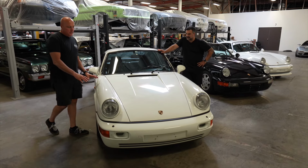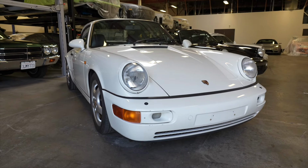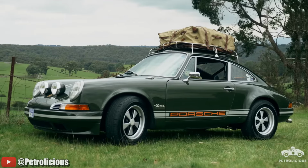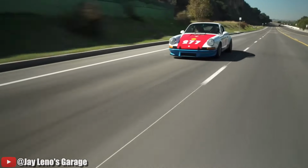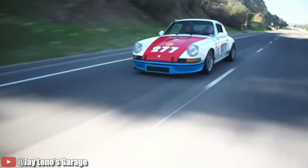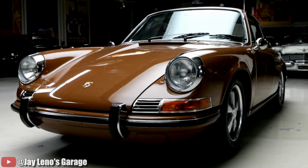Essentially what's involved in doing a backdate is pretty much turning all these cars into what we refer to as the long-nose Porsches of the early 70s. It would require replacing the hood, the bumpers, and the entire front end componentry: the lights, the chrome bits and pieces, the fenders. Yeah, it's the front valance pan, right? The bulb nose or whatever? Yeah, the valance pan and the little bumperettes and the little turn signals that have a chrome edge to them.